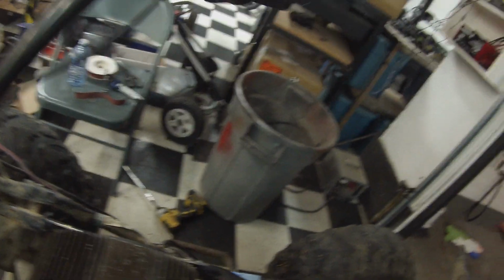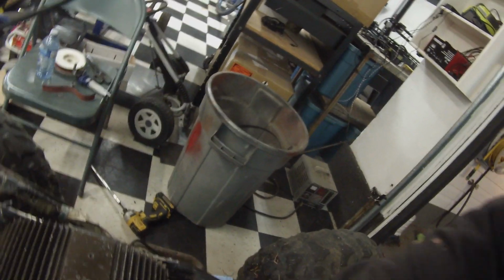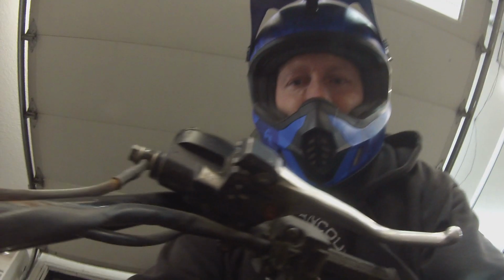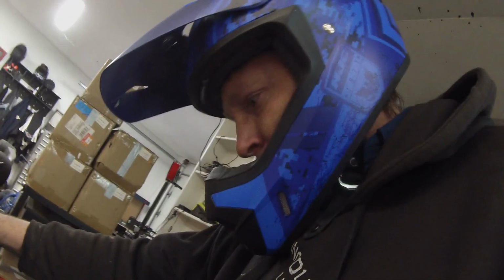So I got that shut off. What I'll do is, to be safe, I'll unplug one side of the battery and I'll find a 12mm wrench and tighten those up. 12mm ratchet wrench here. Now this is exciting. 3, 4, 5. And it was just the positive post was shorted, so it's in neutral. Should run again. I'll do one quick last test drive if it works. Oh, I gotta plug in the battery.